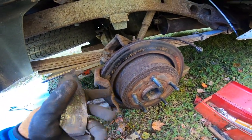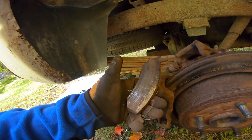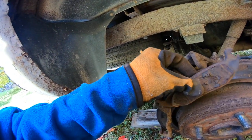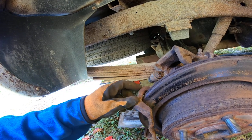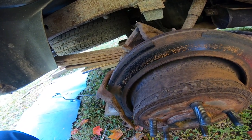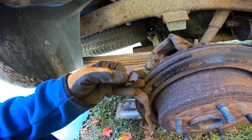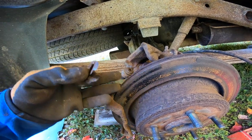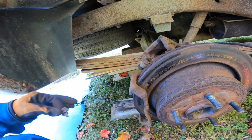But what they're talking about, why you shouldn't put new pads on old rotors: see the grooves? These grooves form, and when you get a new pad, it's all smooth, and it creates a roughness. And I guess the vibration can jam up your pad. But you can see what happened to that top. That one pretty much disintegrated. So once this jams up, your pads can't slide, which then seizes your piston, which then seizes your studs, which then wrecks your rotor. Maintenance goes a long way, guys.